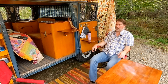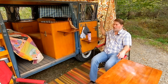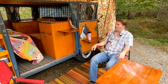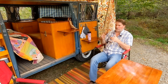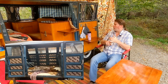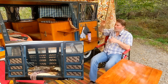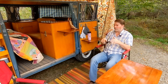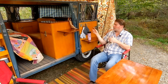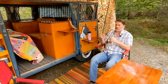So the bus has a sound deadener and insulation, and that's why it sounds like it's got body filler in it, but it's actually a sound deadener. I use Kilmat, their thinner level one, because weight again was a big issue, and I only put small patches in the center of all the panels, and a few around the roof to keep the vibration down. I didn't cover everything.